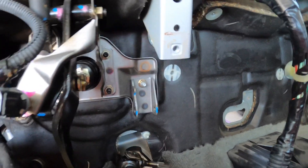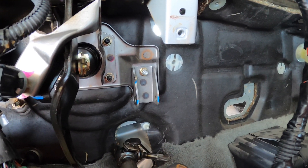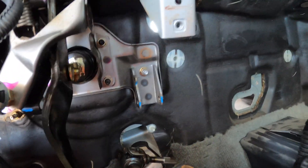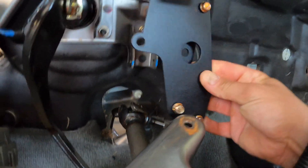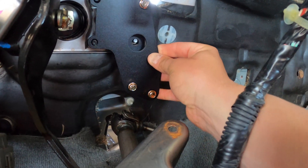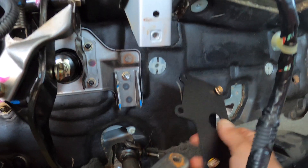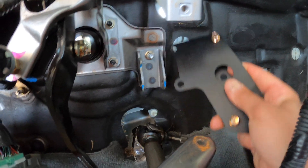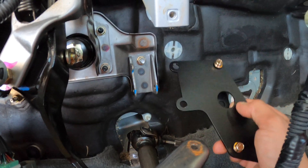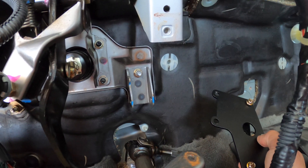The pedal came out — just a cotter pin. It's a little tight on the left side but I managed to get it out. Looking at the bracket I'm going to use, it'll mount right here onto that stud. The problem is there's a bracket that has to be removed, and those look like spot welds, so I'm going to have to drill those out and then remove it so the new bracket can mount up.